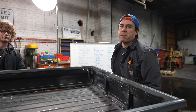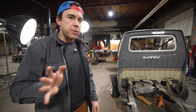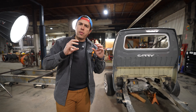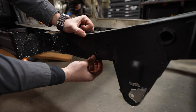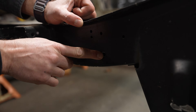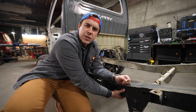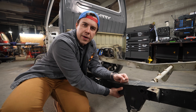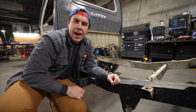The frame on a K truck is made of paper. K trucks don't really have frames in the way you're thinking of — a big thick piece of metal shaped into a C. K trucks have shaped sheet metal that's really thin. I drilled a hole there to show you that this is just thin paper. This is not going to support 550 horsepower. The minute we step on that pedal it's going to rip off whatever it's attached to.